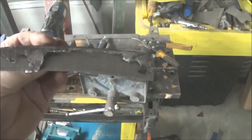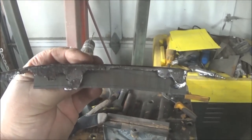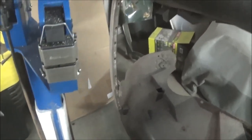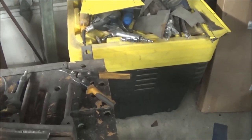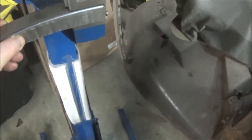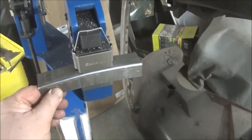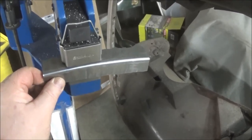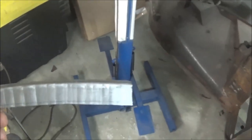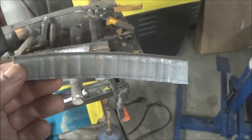This part is going to be hard to show, but there's the outside flange piece and there's a slight curve to it. What I've been using is the shrinker/stretcher — specifically the shrinker — to make that radius. All I've been doing is putting the piece in, and it's foot-operated to bring the jaws together, then moving the piece through the shrinker to get that curve. Depending on how much curve you want, you can run it through several times with different amounts of pedal pressure to get a bigger curve.